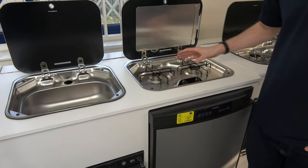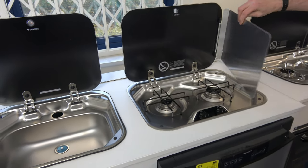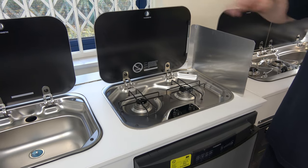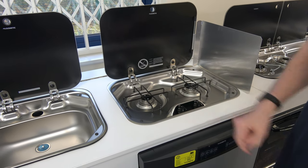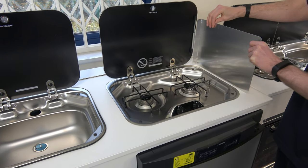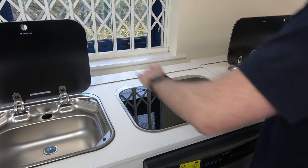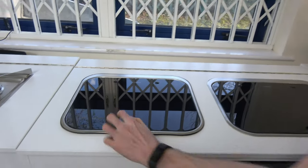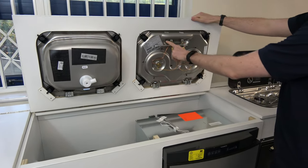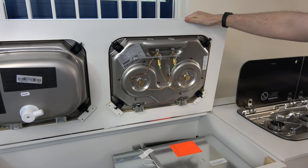When we have a look at the 8005, we have a heat shield integrated into the glass lid, which is also heat resistant. We have a 1kW burner and a 1.8kW burner, both with flame failure devices fitted. On the underside we have an 8mm pipe for compression gas fittings.